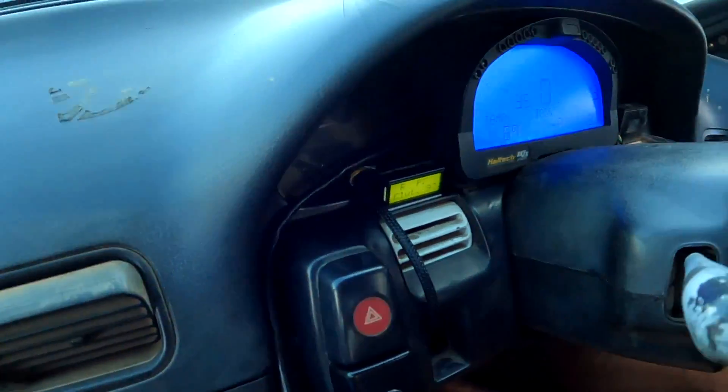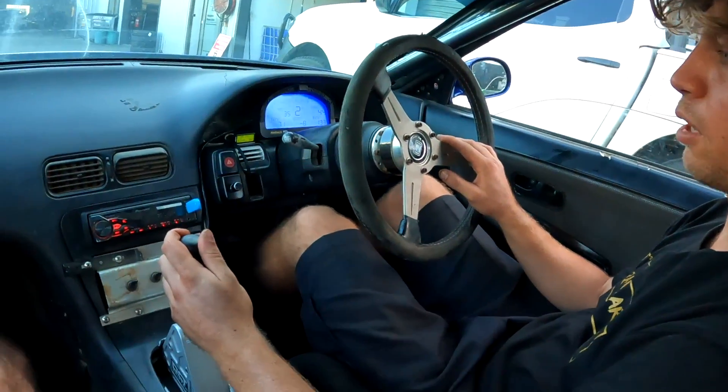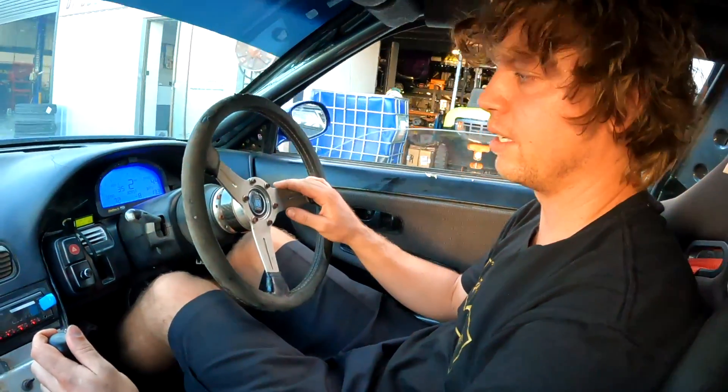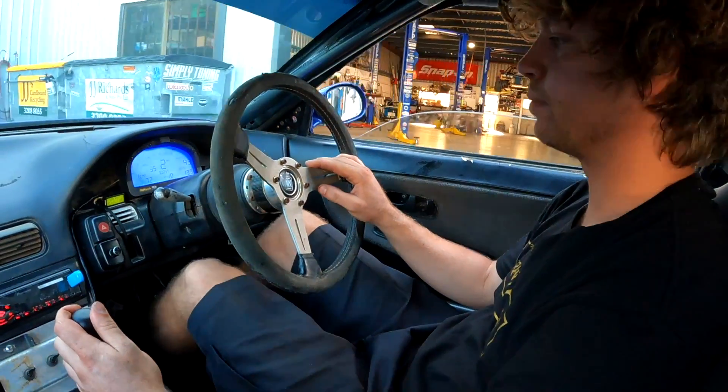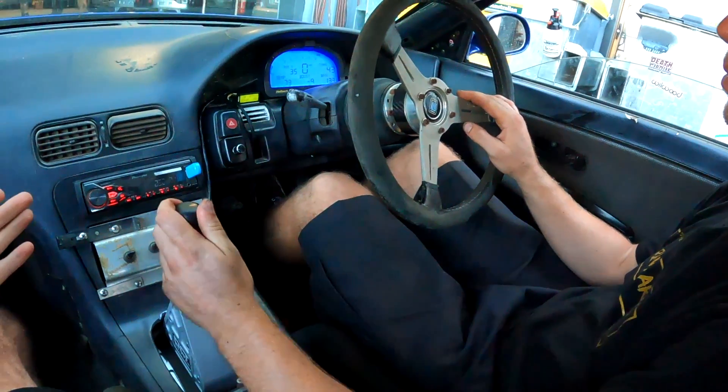That was real easy. Back to neutral, into first, ready to go drifting. We lost the light but I hope the audience can see. Using the piece in place of the slave - well, master cylinder - we've got a pretty easy setup now to add a clutch pedal to your 8HP, which is crucial for drifting. About 80 percent clutch was used there, introduced more when the diff started loading up, but it felt pretty normal. It's amazing how it's still progressive and it's all electronic.